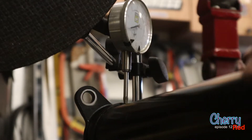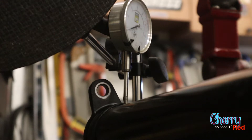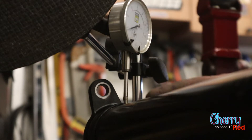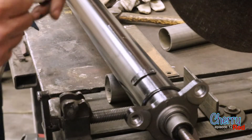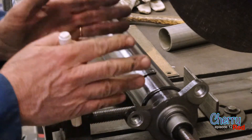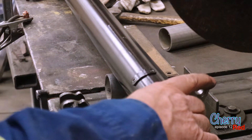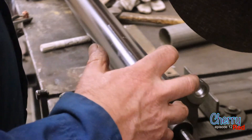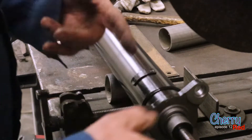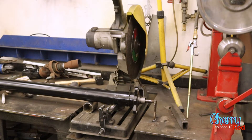At the very far end it goes down to twenty thousandths, so obviously the pipe they've welded on there is not as aligned as it could be. This is a very important line, but the purpose of it is: when you cut this and spread it apart or bring it together — depending on whether you're shortening or lengthening — you still want that line to line up. The way the thing is engineered, the rubber flange and the rubber flange on the other end are intentionally out of alignment — probably so they counteract any vibration.